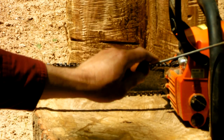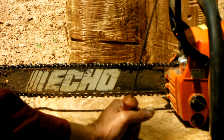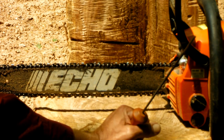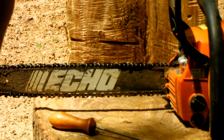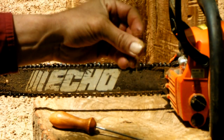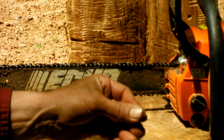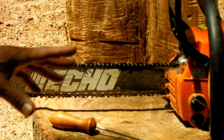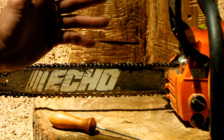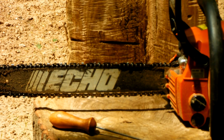when this chainsaw comes outside with me, so does this. I sharpen it a lot, and it just makes a world of difference. If you're getting dust like this, it needs to be sharpened. And of course, the reason I got dust here is because I was just barely hitting it. But anyway, if you're not seeing chunks fly out when you're cutting wood, your chainsaw's dull. It needs to be sharpened. So anyway, just a little tidbit there.